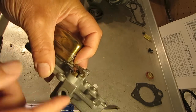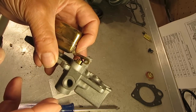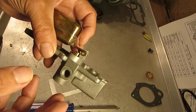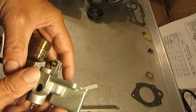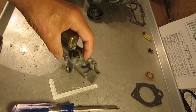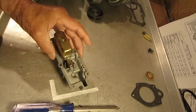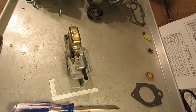Okay, and a new needle, like I say, you should wipe off with mineral spirits, otherwise it'll take about 10 up and down motions before it gets washed off in actual use. So anyway, that gives you a way to pre-check the needle seat before you put it on the vehicle. Alright, so that's how you adjust the float on a YH. Thank you for watching.